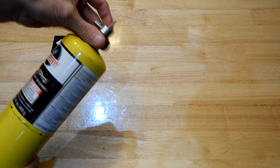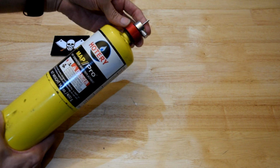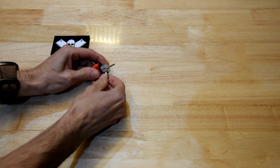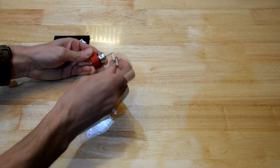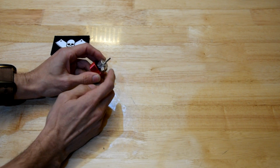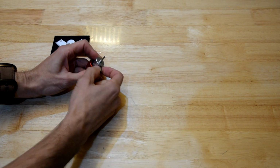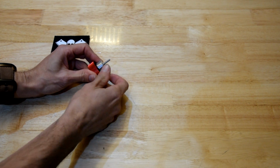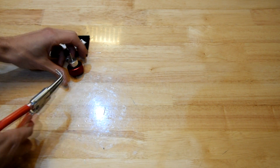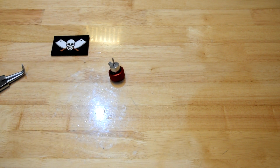Now, there's a couple of little things. Obviously, you need lubrication, which isn't provided in the propane alone, and that's why there is a fill port on the side of this thing, which is for putting your silicone oil into. A lot of people have been talking to me saying that they've had problems with the fill port, with the gasket or the O-ring on the actual fill port thing, and I just thought I'd crack this open and show you guys what actually goes on inside this adapter, so that you've got an idea of what to do and what not to do.